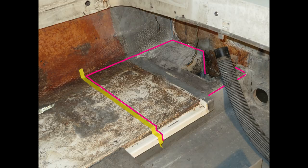When this boat first came in we did a core sample of the floors and we already know that the flotation foam is very wet and needs to be removed. We also learned right away that the swim platform brackets in the transom — those backing boards were rotten, which is not uncommon. So to repair that and get access to the foam we're going to cut a section of the rear floor out.